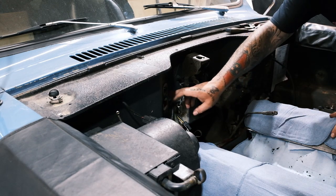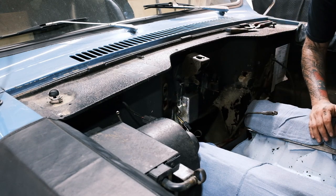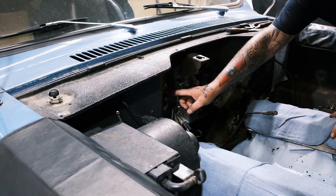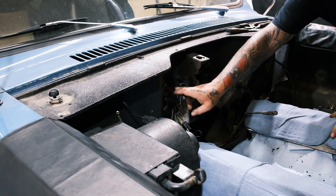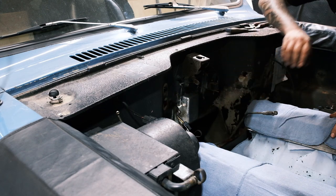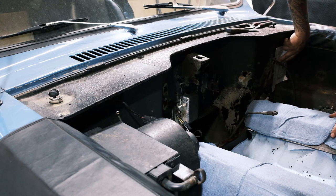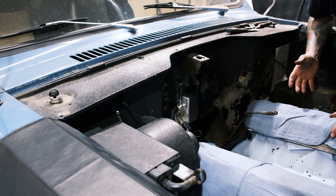I don't know how well you can see that, but previously the connections for the engine compartment and the tail light harness were made through connectors that went into the firewall here and here. And the lighting side was in a hole somewhere over in this vicinity. I don't remember. Yeah, right here behind this little guy. That was the early style harness.